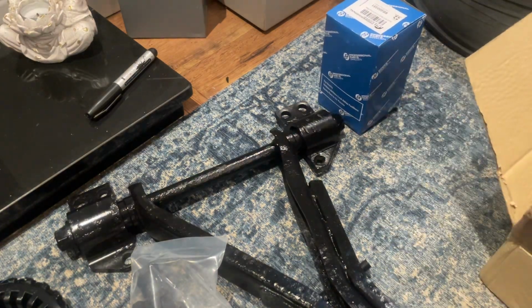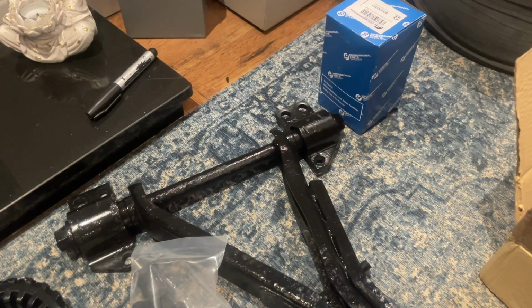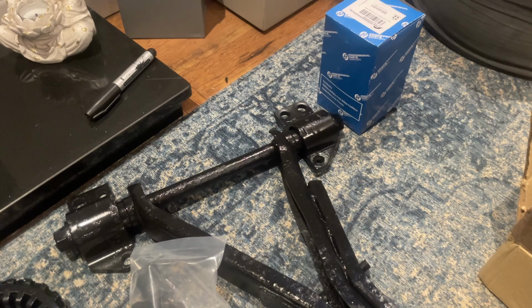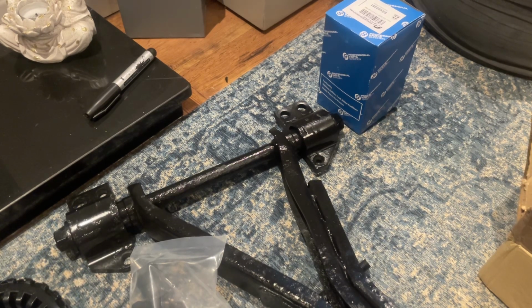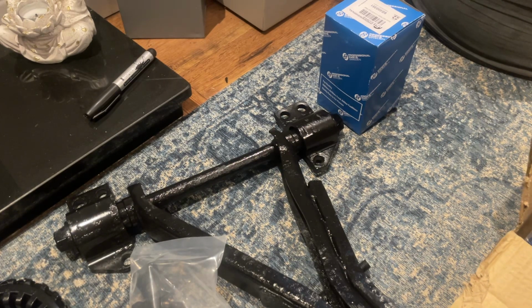So, again, something that I can probably replace, or I will replace, with consumables like the brake discs, the brake pads, everything else. I need to get the brake up, which I'll show you in the next video. I've half restored most of it and got the piston seal kits in. But I've got to get the hub pulled and the bearing released because I'm going to put a new bearing in it. I think there's a tiny bit of slight play in there, but while I'm doing that corner of the car, I may as well nip it in the bud.